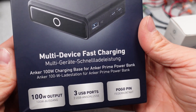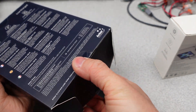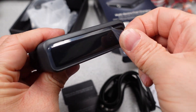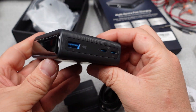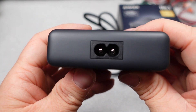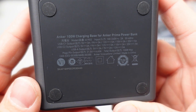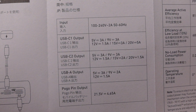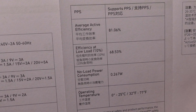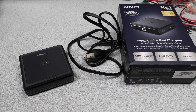Last up is the Anker Multi-Device Fast Charging 100W Prime A1902. This adapter comes in the biggest box with the most confusing package. The adapter is brand new, just on the market in July 2023. The easy-to-open box immediately failed as soon as I tried to open it — copying Apple here, but failing miserably. The adapter is a three-port device with two USB-C ports and one USB-A port, with a shiny finish on the face. It has the requisite safety marks and the DOE6 logo. The user manual has some efficiency numbers and other details, though the stated efficiency values are very low — if this thing was that inefficient, it would literally melt without a cooling fan. We saw this on the last Anker power adapter as well.